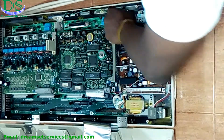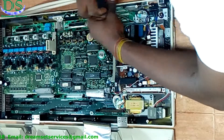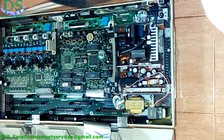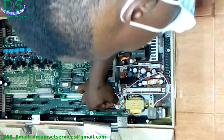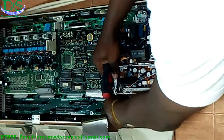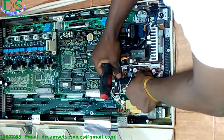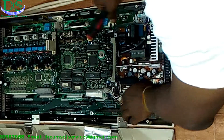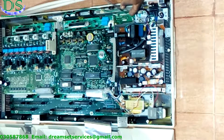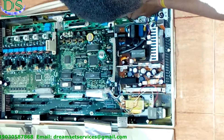I'm going to gently remove all the cables, but to get access I have to remove all the screws in these areas. This is one of the cables I was telling you about — you can see it is disconnected. Make sure all of them are disconnected and be careful not to cut any of them, because if you cut any by mistake the cables are short, and joining them back will become an issue unless you have another cable of the same type to augment the length.